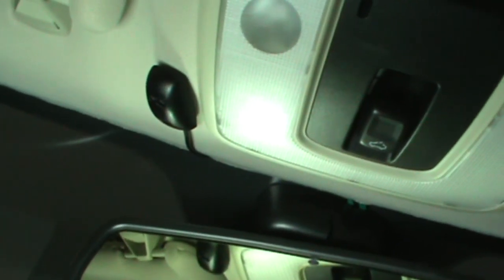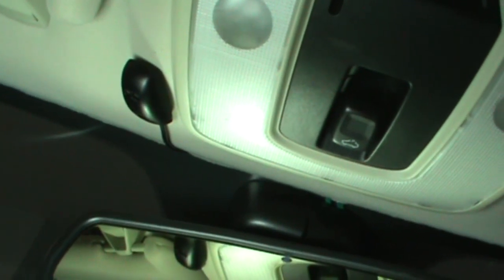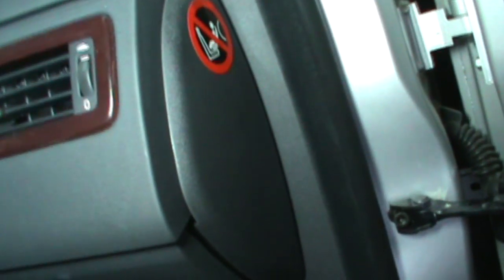All right, so there's the microphone installed. They wanted it installed on the light diffuser, but I didn't want to install it there. The wire runs across the top of the car between the roof and the headliner, past the visor, to the A-pillar. Take that little piece off there and unscrew it, and that'll remove the A-pillar. You go down the A-pillar to the bottom, and then you run the wire along the side. That panel removes. That's also where I installed the module, and then the wire runs down here where I have everything connected up.